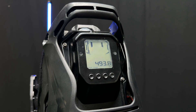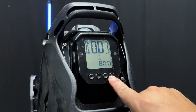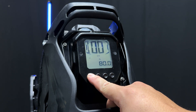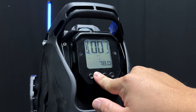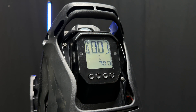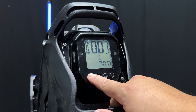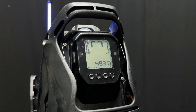To go into the menu adjustments, click this button until you hear the beep, let go, and using the up and down arrows you can navigate through the menu. Let's say we want to adjust MD, which stands for ride mode, which adjusts your pedal hardness. You can hit this and adjust up or down. The lower this number, the softer the pedals will feel, which means that the pedals will lean in the direction that you want to go. Some people like it a little stiffer, some people like it softer — it just depends on your ride preference. To back out and save, just hit this quickly one more time, and you're completely back at the main screen and it's saved.